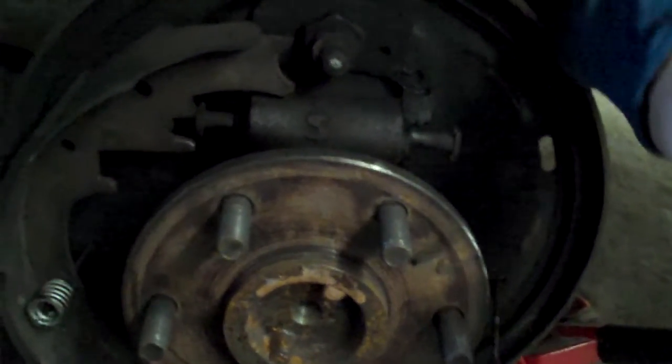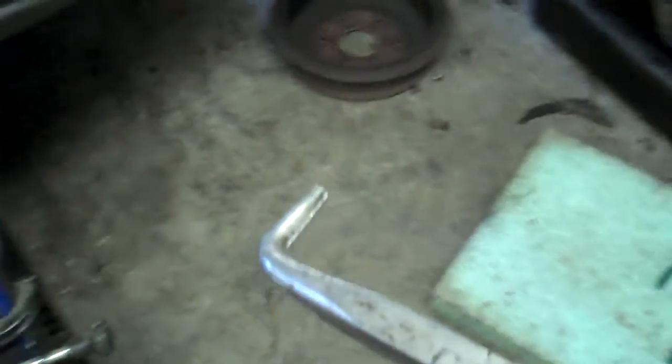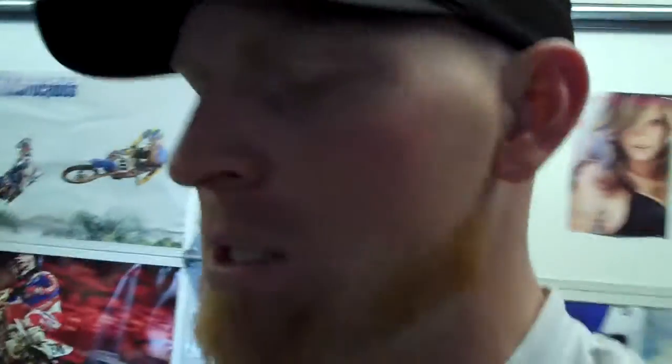Assembly is just a reverse of the way you took it apart. I like to use these 90-degree angle pliers on the springs because they kind of hook into it — that way I'll grab the spring and just pull by the strength of that. I hope that's helpful for you. That's just a little crash course on the basics of drum brakes. I hope you enjoyed. If you did, be sure to favorite, subscribe, thumbs up — it'll help promote the video. And happy St. Patrick's Day.